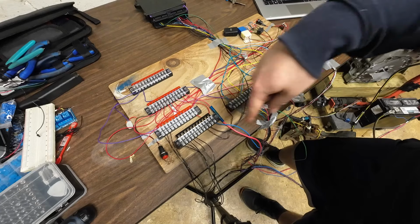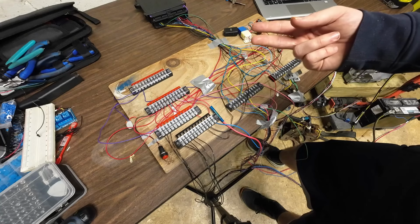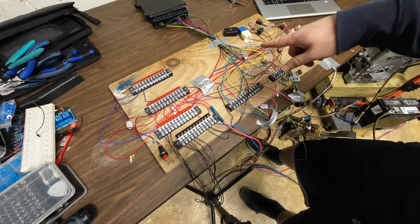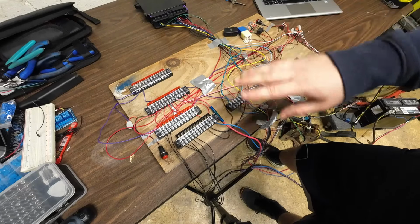That way, we have a complete loop, and that pre-charge is a contactor that goes through a resistor. So then we turn on our positive contactor and then turn off pre-charge. That way, we have both contactors, no resistor going through the battery pack, so there's no rush surge current to the charger or to the inverter.